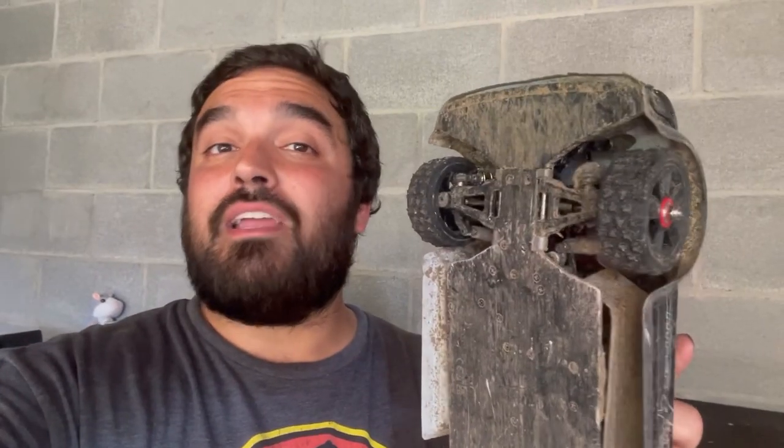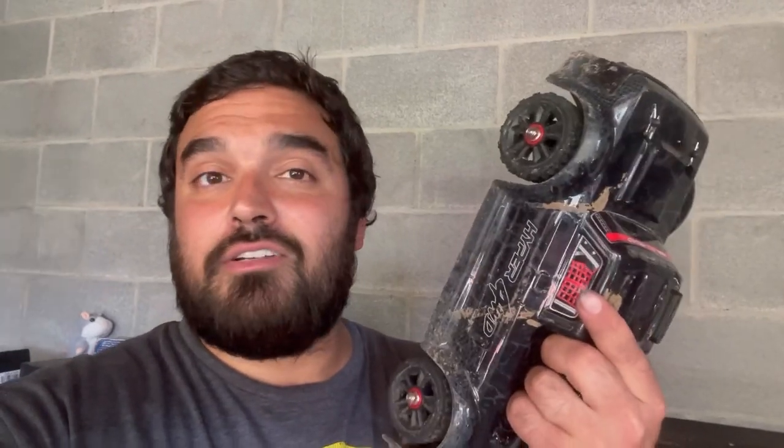It is a new day and it is dry out there now, even though it rained a whole lot again this morning. I haven't cleaned this out yet, but we're gonna keep running it on 3S. Now we have the dry pavement and we're going to mess with the gyro this time. So we'll do it with the gyro still at 0%, then we'll turn it up to 50, and then we'll turn it up to 100, and we'll see what kind of differences it makes. I don't know if it'll make it easier or harder to drift. We'll see.